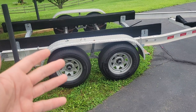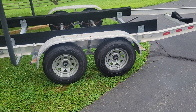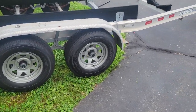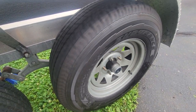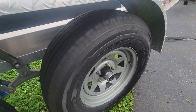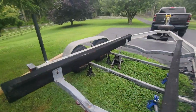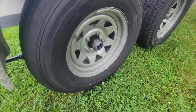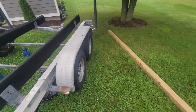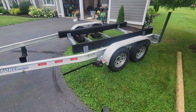What I'm going to do today is take off all the calipers, blow out all these lines, and try to push out whatever gunk might be in there — hopefully nothing. That's the plan. I've got this up on jack stands. I'm going to spin this — this one is bouncing around because I only have two bolts on. You can hear the brake kind of grabbing in there. I think I've got the bearing set correctly with the castle nut. That's the brake pad rubbing. They spin nice but I can't take the risk, so I'm going to take off all the calipers and go from there.